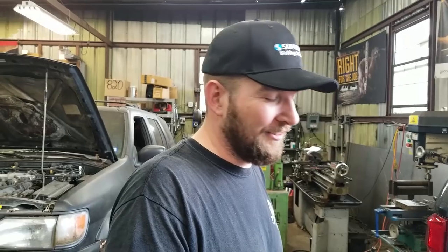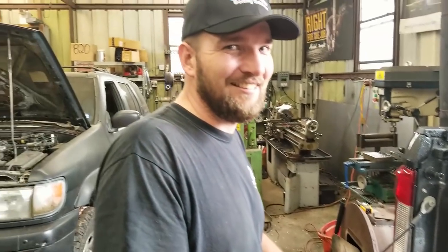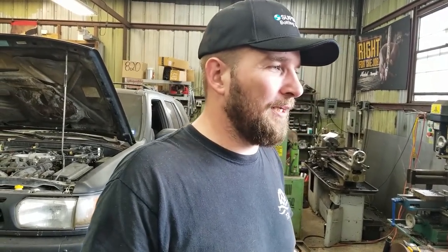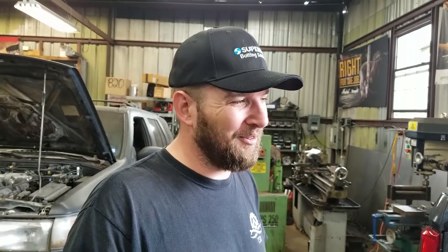Now all of their hitches are welded to the frames of the trucks, which is a terrible idea. Don't do that. For liability reasons alone, I don't think on most vehicles it's that big of a deal metallurgically — definitely on newer trucks like this I wouldn't do that. But anything 2004 or prior, if it's a Ford, I read up on the metallurgy of the frames on the Super Duties and from what I remember it was fine. But obviously double check that because I'm just some random guy on the Internet. Seriously guys, don't weld these to your truck.